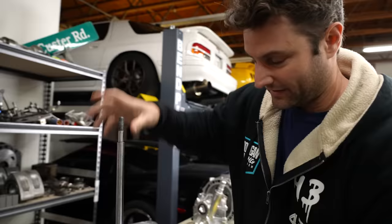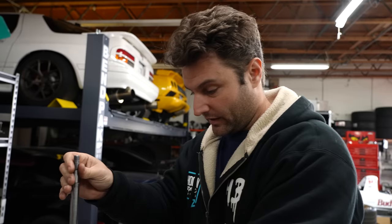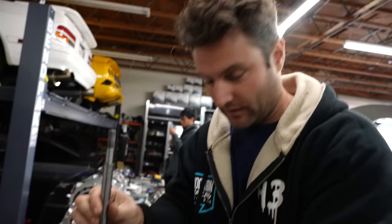Thankfully, the whole motor would be holding it all together, but this is something that I want to address now and helicoil. Now, it is very common on professional motors actually to helicoil either cast or, more importantly, aluminum, because aluminum and steel with threading is bad. I'm waiting on Amazon to send me my helicoil. It's supposed to be delivered right now.